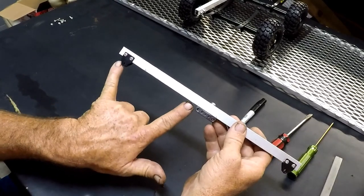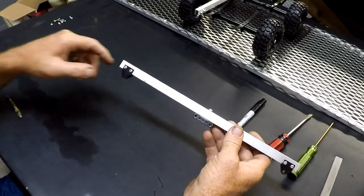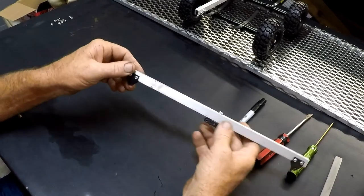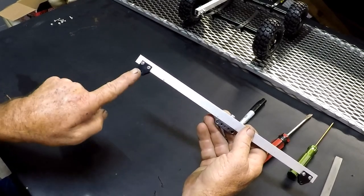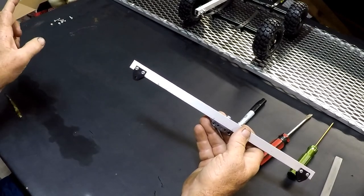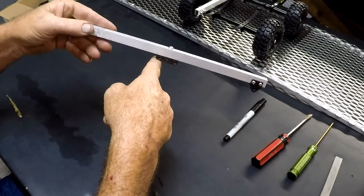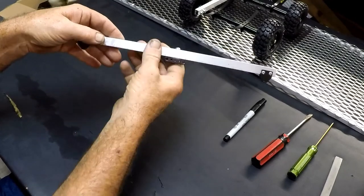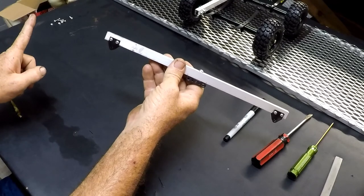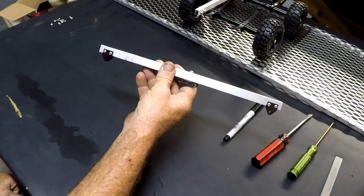I'd add roughly 6-7 inches to one side or the other. Since we have this run here, I would put another one of these here, and then on this back side I'd put this here. So I'd have my attachment, spring, then here's a spring to this cap here, to here. And then I would run my spring to this cap that's going to be back here. That's how I would do it and be able to run a triple axle.